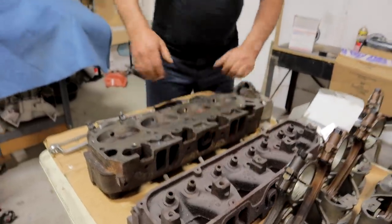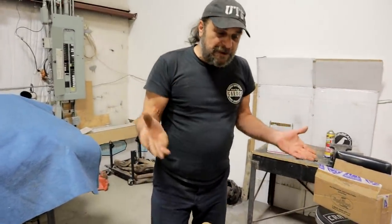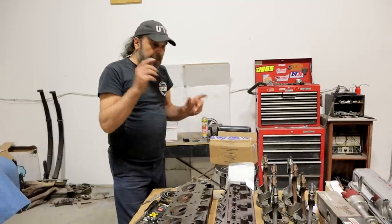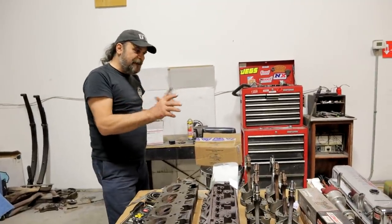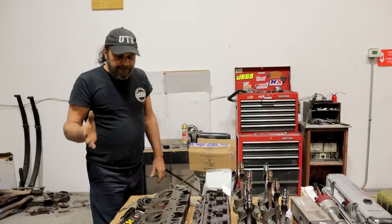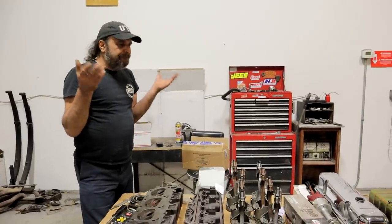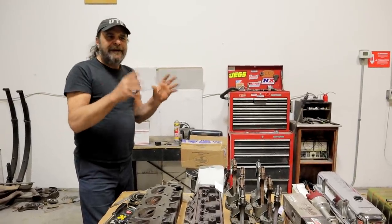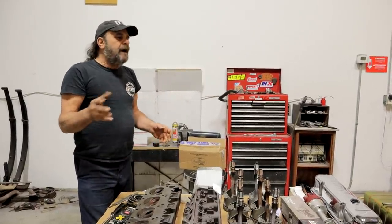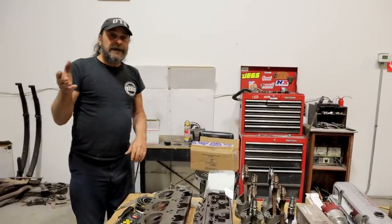That's all part of the blueprinting process, and it is repetitive and it takes time. Last night I spent probably a good five hours measuring the pistons and double-checking things. It takes time, it's very tedious, very time consuming. By the time we're done fitting this whole engine together, marking it all and checking everything, you're talking about probably a week — a few hours a day or a few hours a night — going through all of this, and that's before you actually assemble it. Because after all this mock-up work, after you've measured and clearanced everything, it all has to be taken apart, cleaned, and then put together for the final assembly.